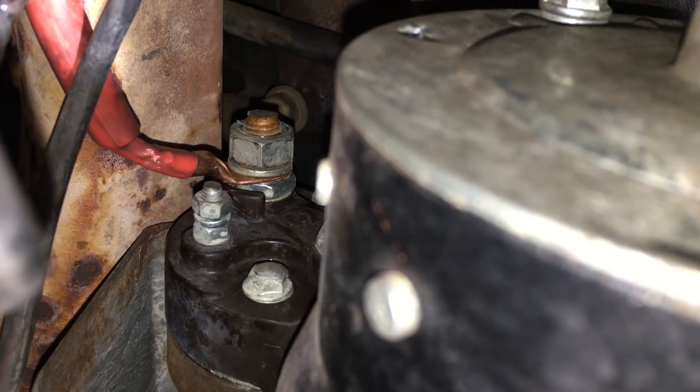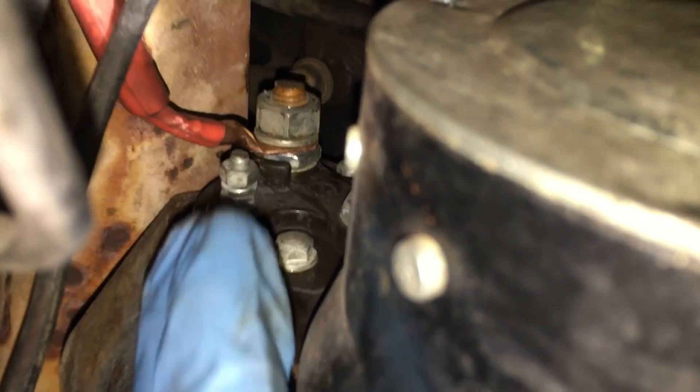Now that we've got everything sealed up, this is our new terminal connection. Let's go ahead and reattach it to the starter — and there's our new connection to the starter motor, we're good to go. It was a learning experience: I used to think soldering alone was good enough, but crimping is a necessity if the cable is attached to something generating a lot of heat and vibration. Let me know your tips or tricks in the comments, give it a like, subscribe, hit the notification bell — hope to see you in the next one!